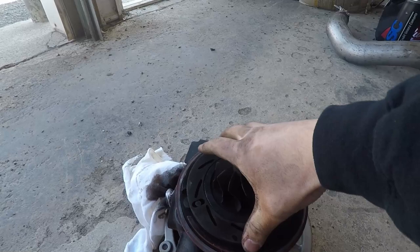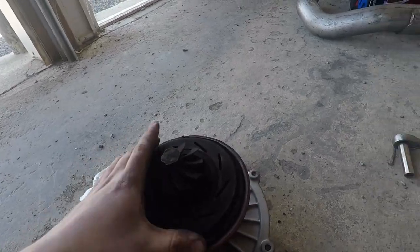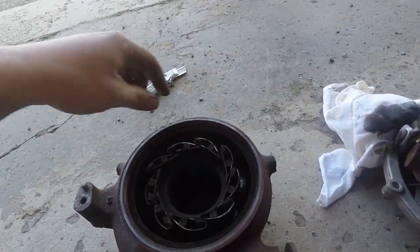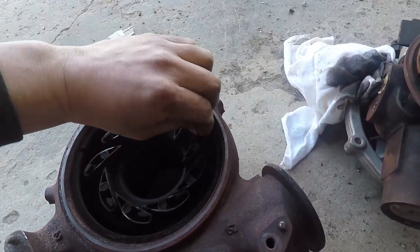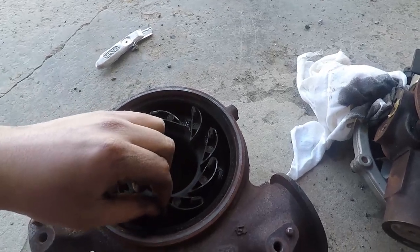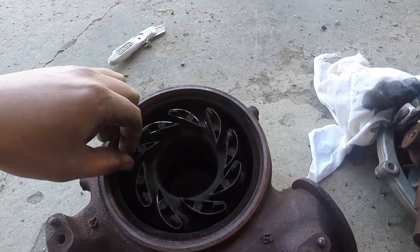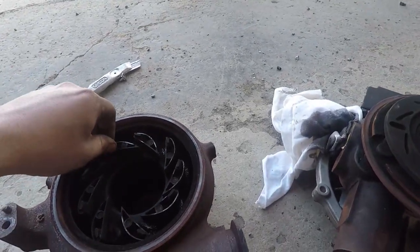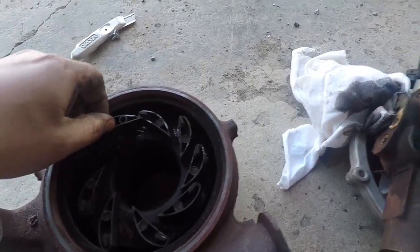The other thing is to check how this moves on here, and this isn't stuck, so we're fine - this is moving freely. We are going to clean it up since we have it apart, because why not? The other thing you want to do is come over and start checking your vanes here to see if they're getting stuck. Most of these are moving super free - these guys are moving great. These over here have a little bit, but that's just some carbon coming off. For the most part these are moving free too.